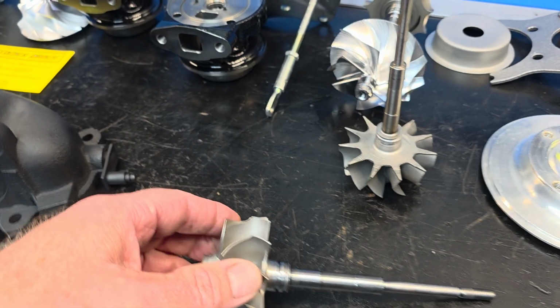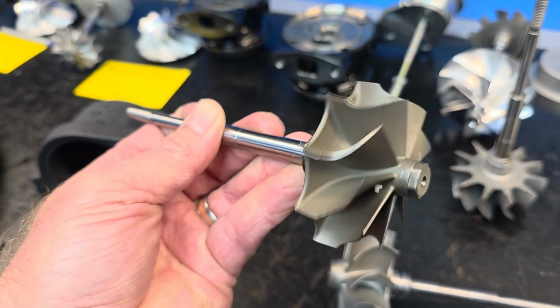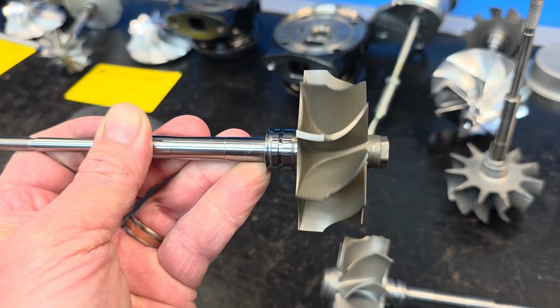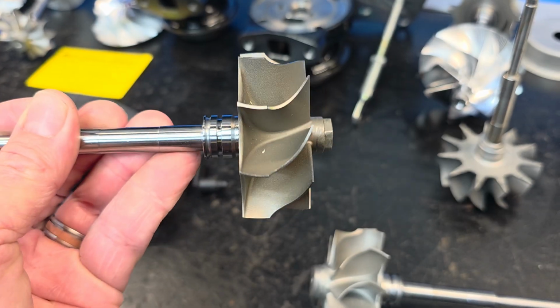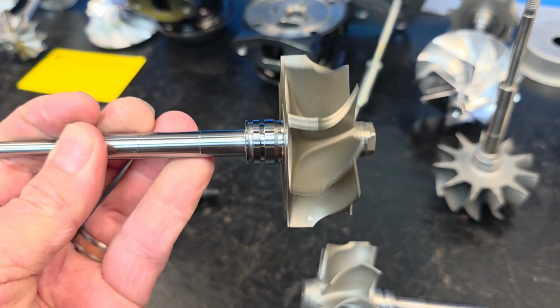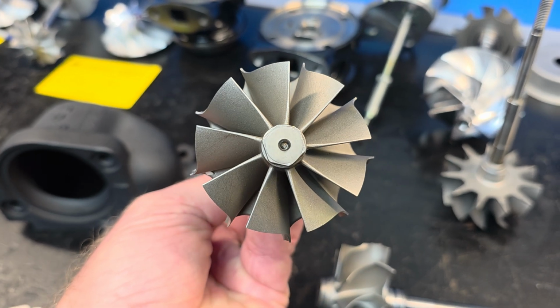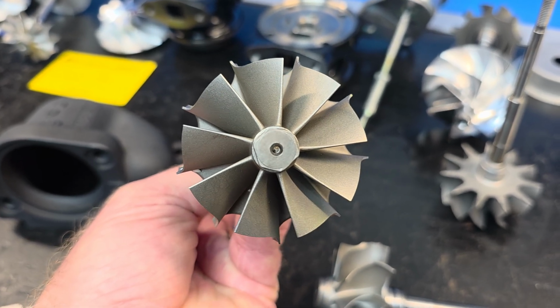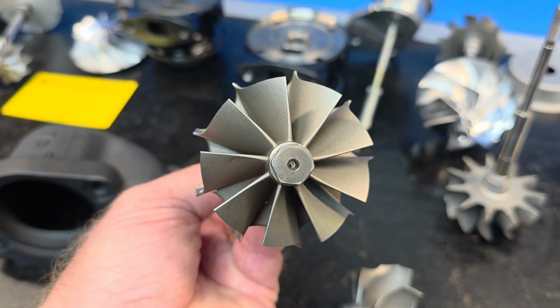So what we're doing in the Buick world, we go to our 9-bladed turbine wheel. It has quite a bit less mass and a little bit better blade architecture. This wheel works really well, but let's cut right to the chase. It's capable of producing well over 550 flywheel horsepower. So it's still going to be a little laggy on the Z31 without supporting higher compression, camshaft, stuff like that. That's not our assignment right now.